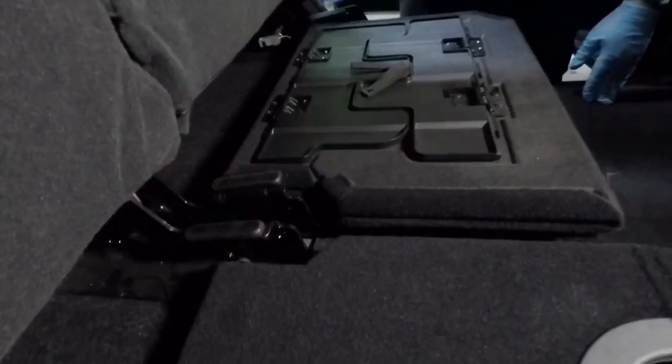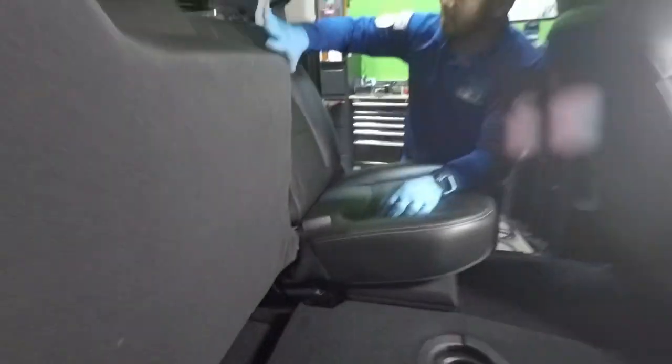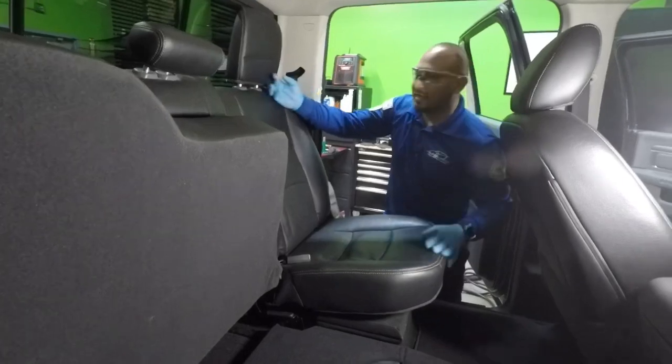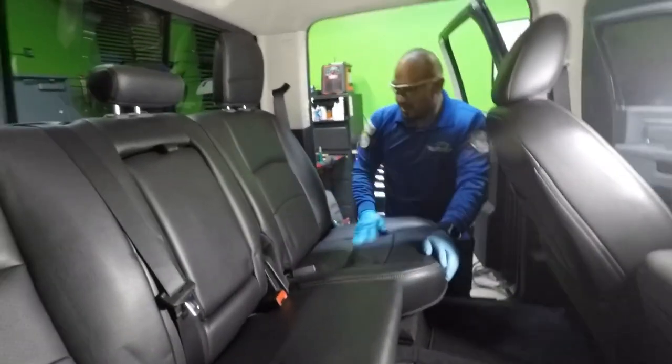The plug, you have to plug this back in, and make sure that when you're sliding the window onto the back, you just slide it right into the bracket. There's an actual bracket. If you forget to slide it, you bolt it in, this thing will come forward. So it's very important for you to keep a note of that.